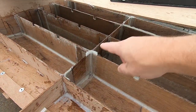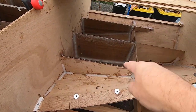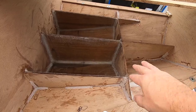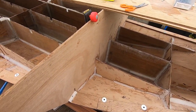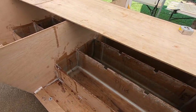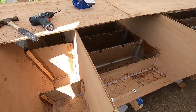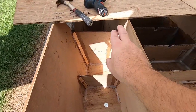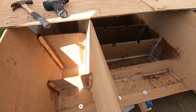Before I put this aside, I'm going to fix this part, get all the tops level, get that straight, and come back and do these. Probably the next time we'll be sanding along the edges here, and probably working in the back in that transom trying to clean that up. This is kind of an overview — it's going to look a lot different once the sides go on. We'll be able to start putting the decks down, routing the pipes and conduits. These are the little gussets — it only calls for them on the stern on the transom, but I went ahead and put them in. I'll come back and sand all that out so the glass goes in there properly. I'm also a little confused — Joe Ortel said to make sure you fiberglass this transom before you flip it over, but the fiberglass has to come all the way to this transverse bulkhead, so I'll probably have to take this cradle piece out.